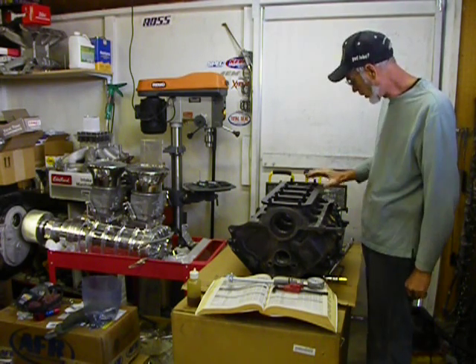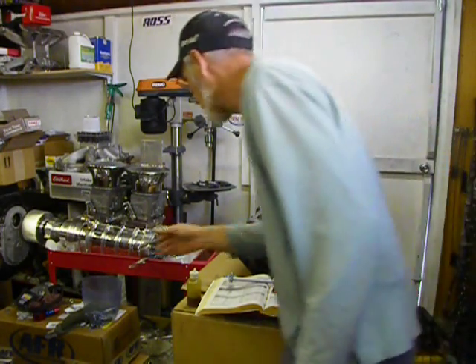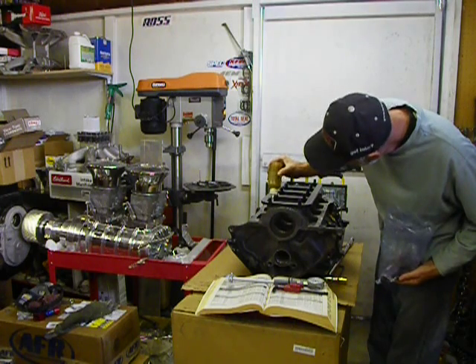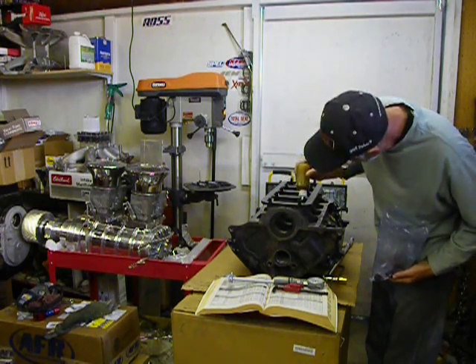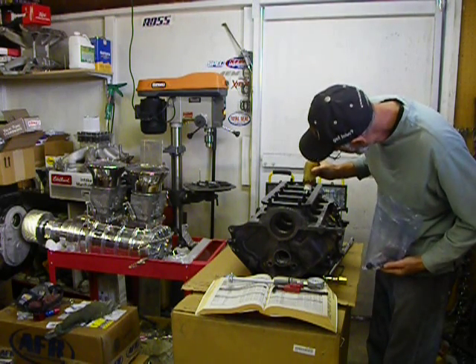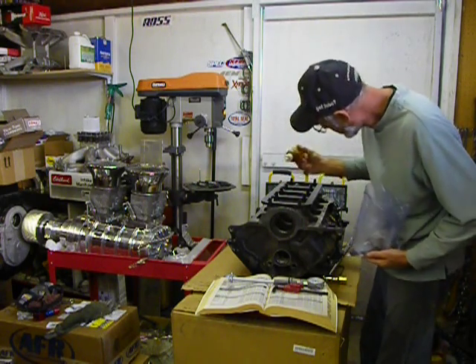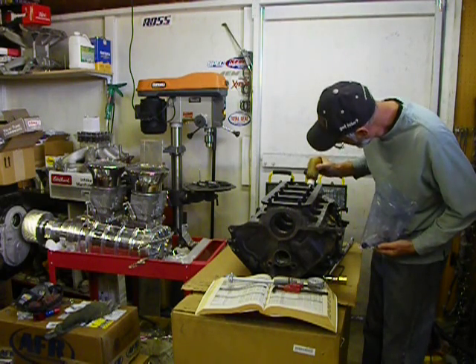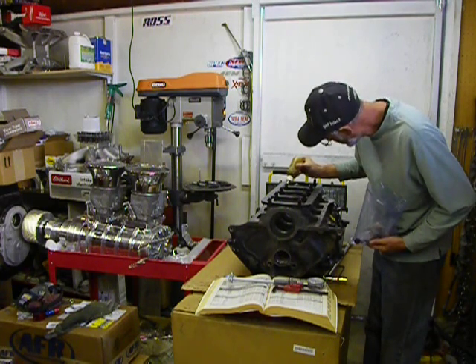On Windsors, it'll wrap out around the oil pump. On Clevelands, it goes on the inside. So put it on the right way around. Get our nuts — once again, a little bit of lubricant. It's more important on this side. I'm going to let this drip down because we're going to put a washer underneath the nuts.